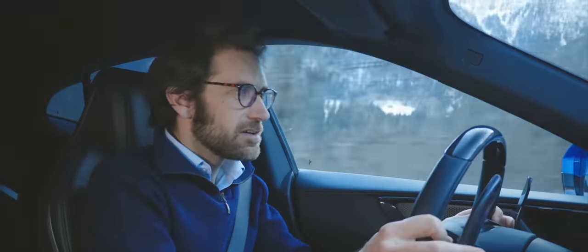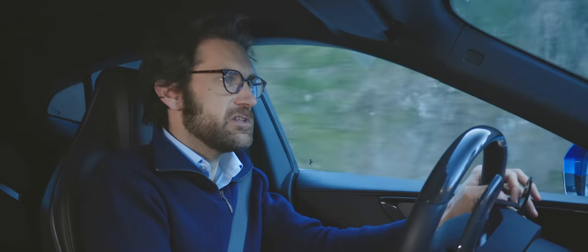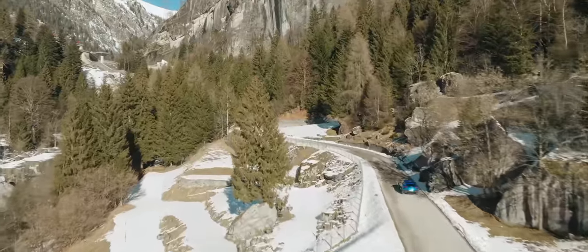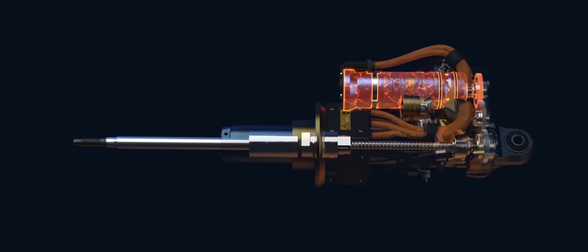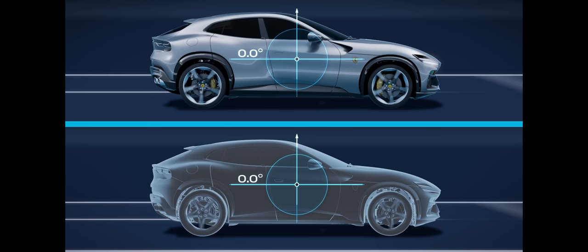The steering's not quite as sharp as other Ferraris, but actually I think that works well. We've also got individual rear-wheel steer, which was first seen on the 812 Competizione. But the really big news is the active dampers. They use technology called True Active Spool Valve, developed by Multimatic. Each damper has a liquid-cooled 48-volt brushless motor attached to a recirculating ball screw, which can either slow down or actually accelerate the damper stem, depending on what the control module tells it to do. There are still traditional hydraulic damper valves, both as backup and because apparently it adds some smoothness. In addition to negating the need for traditional anti-roll bars, the claim is that it gives more precise control of vertical, roll and pitch movements, meaning better wheel control over rough surfaces while also maintaining body control.